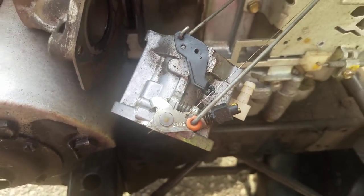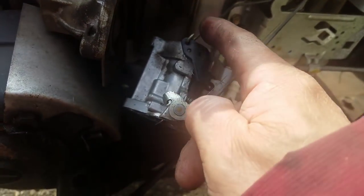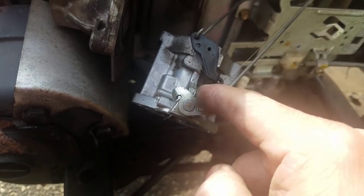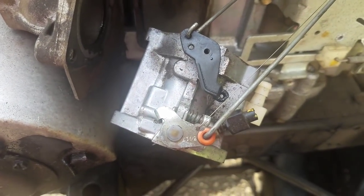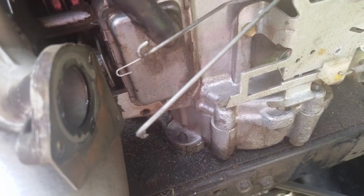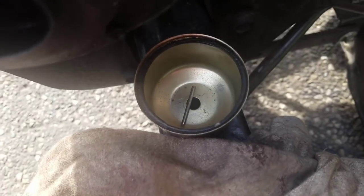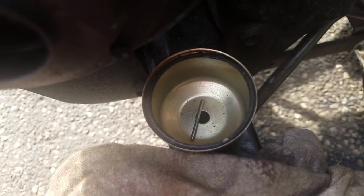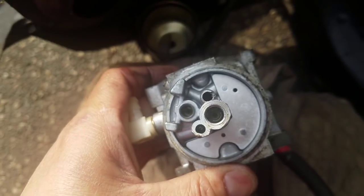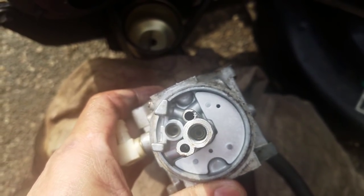Make sure you take a picture of the linkage — the hole to the right is the first hole on the left for the choke, this is for the throttle. The little wire goes into this little slot; it's kind of obvious but it's better to take a picture anyway. I like to lay the carb there nice and gently — you don't want the choke area thing to go all over the place, it's just floating there. The bowl's pretty clean; the carburetor is very clean. I don't see any evidence of any gunk in either the seat area or the emulsion tube area. Float's clean, needle's clean.